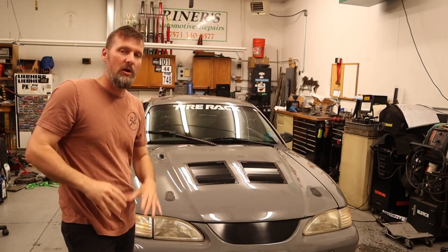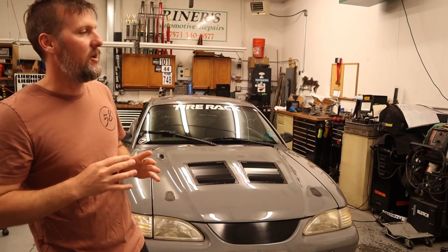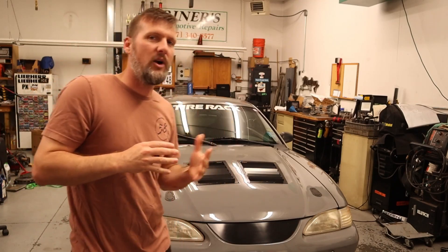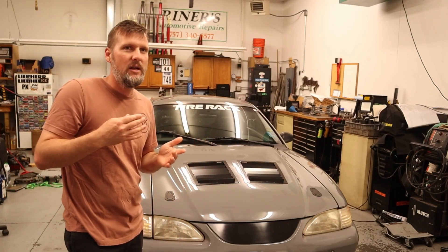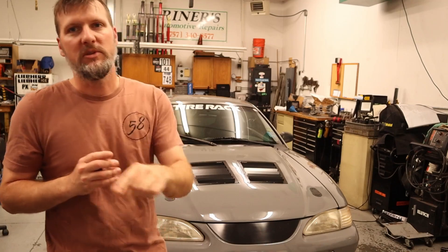Future Steven here. I have taken the car to a couple of autocrosses now, and I can say that I really like the rear suspension change I've made. I don't have the sway bar on there, as I said in the video, but the car rotates so much better with the change. It's a little bit of roll oversteer and some more anti-squat — it digs really well out of the corners. I do want to still try out the middle adjustment; I'm in the lowest hole right now. I'm not really noticing any brake hop either, but the two events I've done have had some hard braking zones, though nothing really demanding. Just wanted to give a quick update to finish out this video. Thank you guys for watching — see you in the next one.